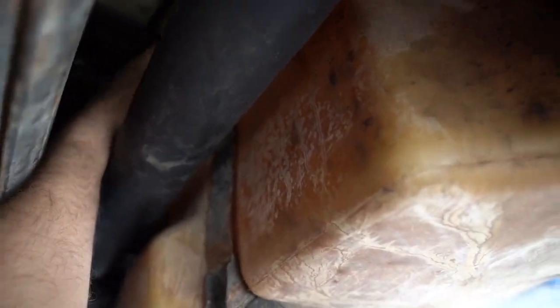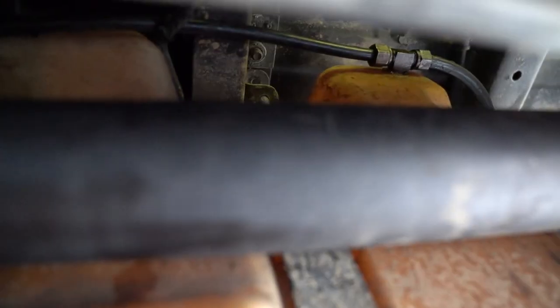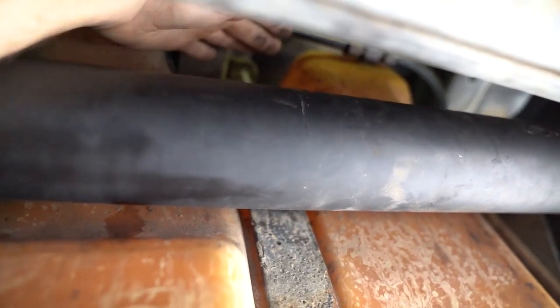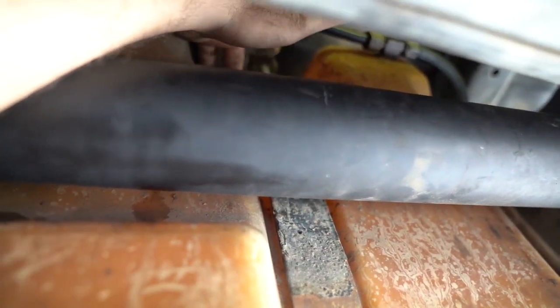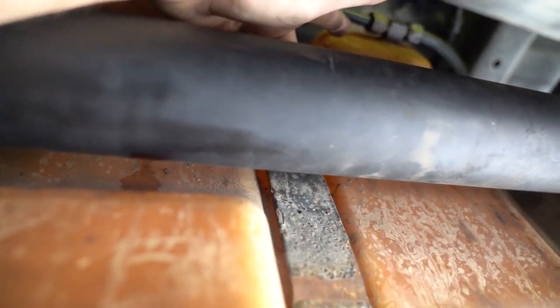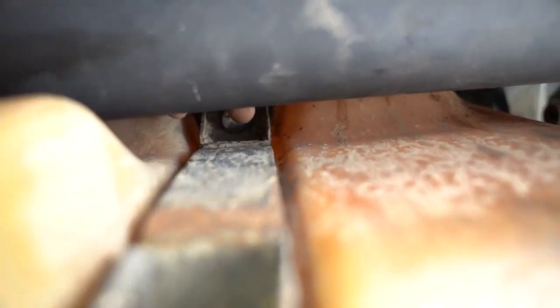I read about someone on Steel Soldiers who added bolts. You can barely see anything in here because it's really crammed. I got some 8-inch bolts — I forget the diameter — and they run from the top tab where the strap used to bolt, all the way down. That allowed the tank to drop down. Of course the angle of your straps is going to change, so I pulled the strap out — it unhooks on this side when you loosen it. You can put it in the vice and I bent it with a little hammer, tapping on it, so that it fits the new angle.